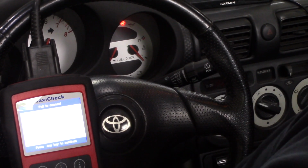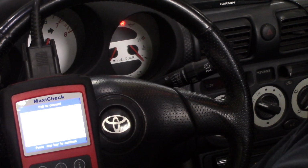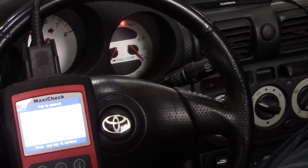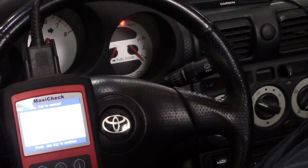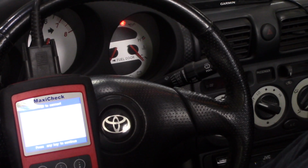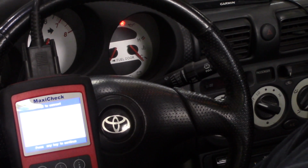Alright, and there's not really a point in showing more than that because at 170 it's entered the normal range, and it's really not going to move until 180. In fact, it doesn't move out of the normal zone until it goes above right around 210 degrees Fahrenheit, and then it starts climbing really quickly.